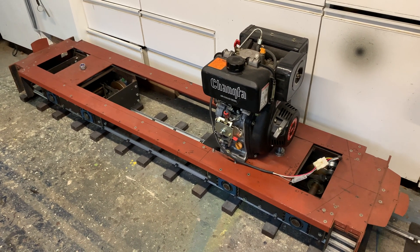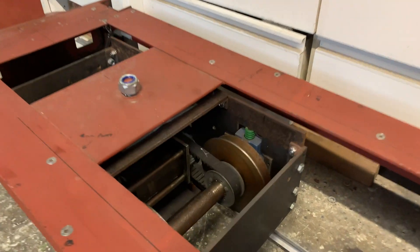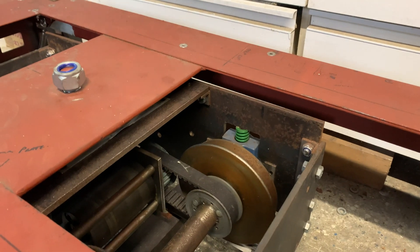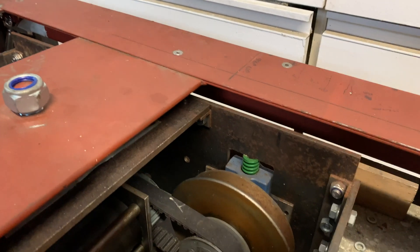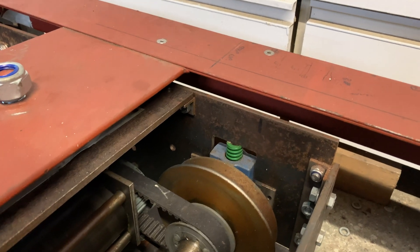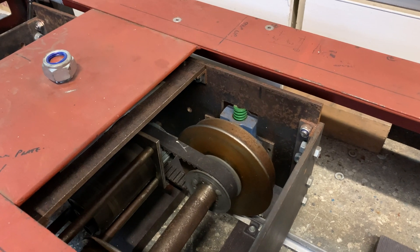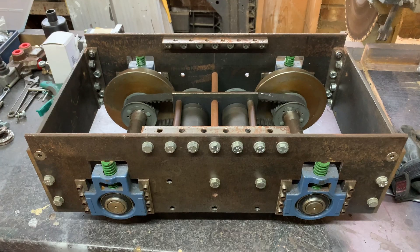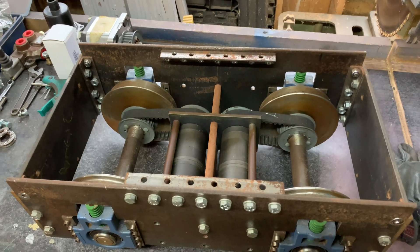And also, I've got to cut out. If we look down here at the bogey, I'm going to have to cut out along there because it's going to fail on the framework otherwise. So that's my next job — take the bogeys off and take them apart and reduce the bogeys. I'm going to strip them down now for painting.